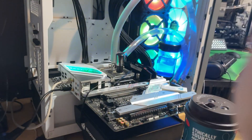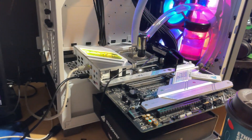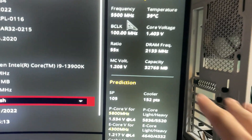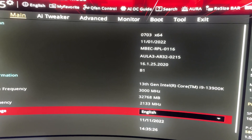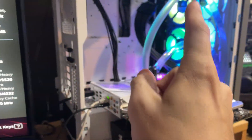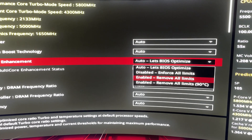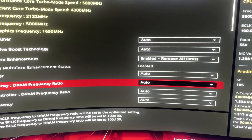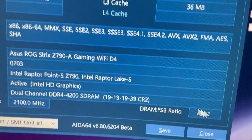I need to move the same CPU to the other motherboard because of memory controller variances. One eternity later — now we're on the Z790 motherboard doing 4x8 first. The SP score shows exactly the same between both motherboards, so silicon quality isn't changing here. I've got the latest BIOS flashed. I'm going to punch in the exact same voltages, start at 4,000, and step up. It actually looks like this one is worse — it errors out at 4,219.